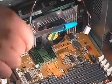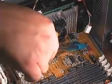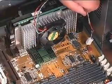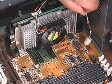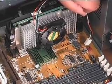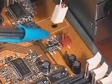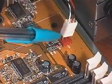This is the connector from the heatsink fan. The ATX motherboard offers 3 different power points. This connector has to plug in with this red 3-pin head that is located between the DIMM banks and the slot 1 connector. It is usually labeled on the board, right here.